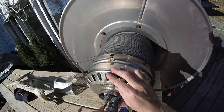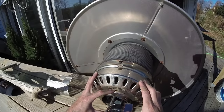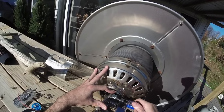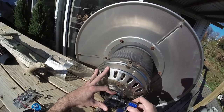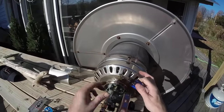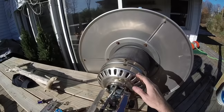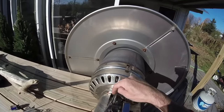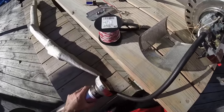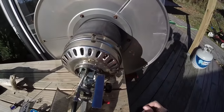If you're comfortable getting everything out of there, just gently push this guy up into place and give it a gentle push. This screw holds it right into place, so give it a little hand tighten — not too tight, right about there, about as tight as it'll go — that holds it in place so it can't pop back out. And that's pretty much it. At this point you'd want to put everything back together: the screen goes on and back into these little grooves, the screws go on here, and then this whole piece screws back onto the piece down here. Push that tube right back down there and hopefully, if all goes well, we should have a working patio heater.